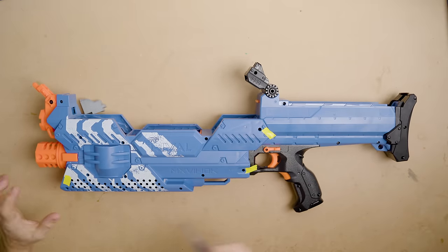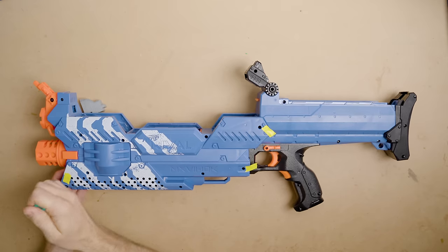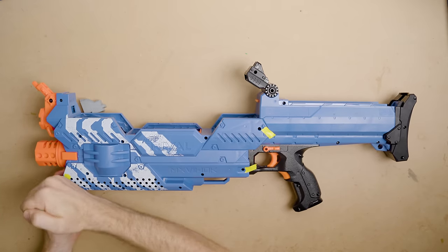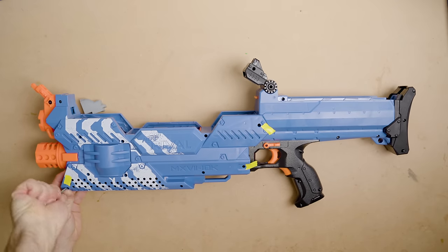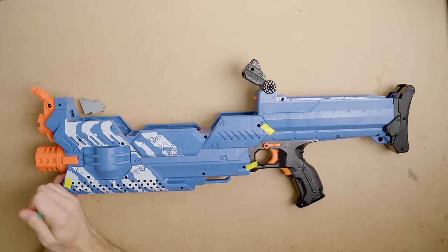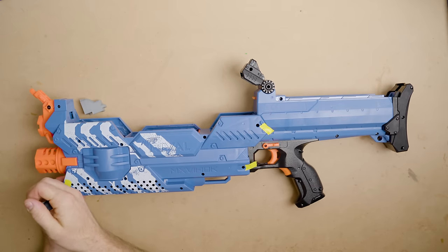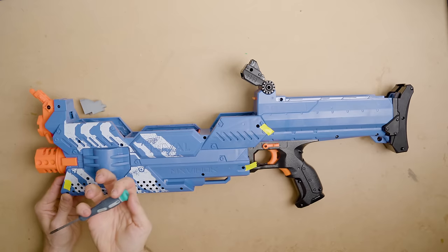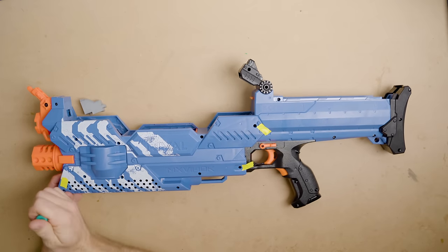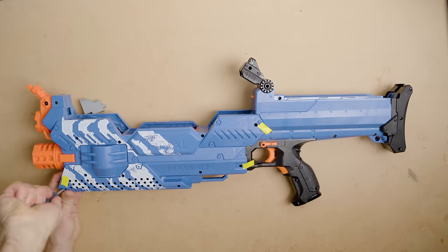I've taken all the screws but the three troublesome ones, so I'm going to be very careful — applying nice, sharp pressure and going very, very slowly. If you're not careful here, you're going to regret it. Do make sure you are using the right size screwdriver. This is a Phillips 1, and if you don't use the right size you are almost certain to strip the screw.